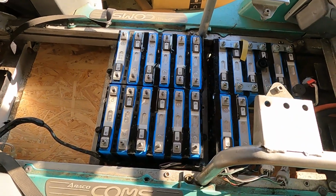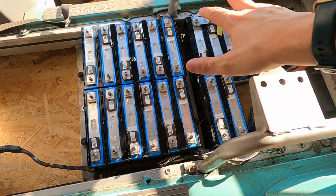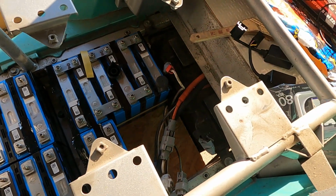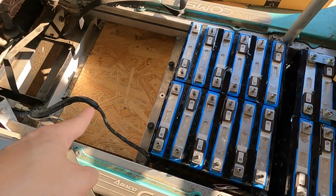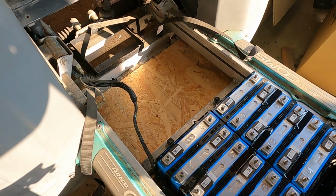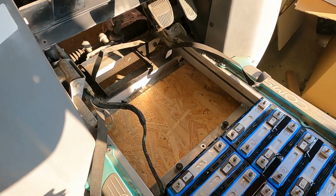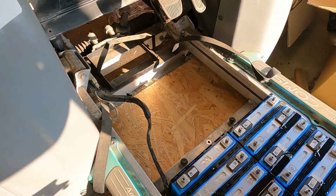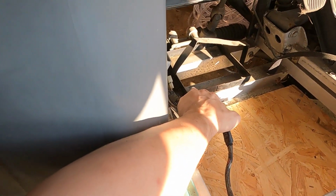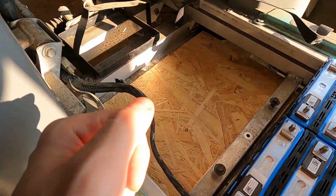Okay, the idea is to put the main 72-volt battery here in the half and the rear part. I will add in this space here the BMS, and in the empty space on the front side, I want to add the new 12-volt battery. A more powerful one I saw on the internet. There are some lithium batteries, 50 ampere, 40 ampere hour, that will never fit in this small space here. So I feel like from a balance perspective as well, utilizing this space would be the best.